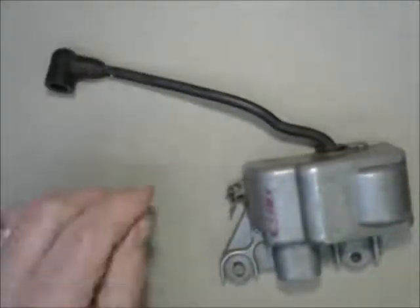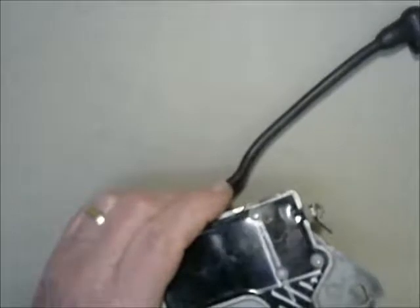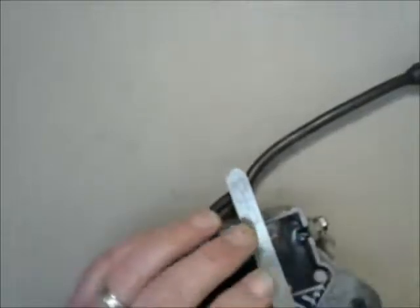The next thing I want to do is suspect the capacitor. I'm hoping the capacitor is the problem. What we need to do is remove some of the epoxy to get to it. Looking at the pull piece on the trigger coil, I put up some lines projected to the top and drew two lines across here because I know that's where the leads are for the capacitor. We really only need to remove the epoxy in one strip between those lines.